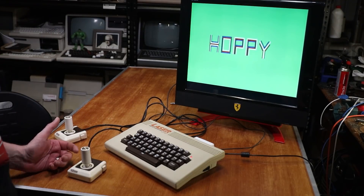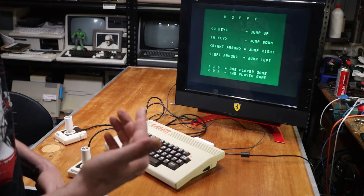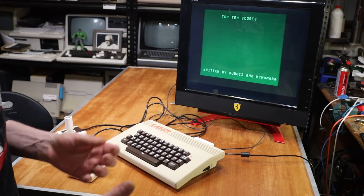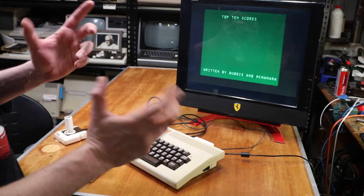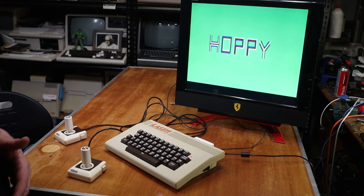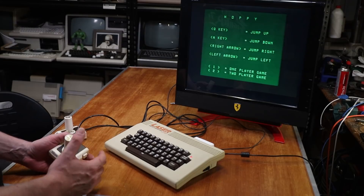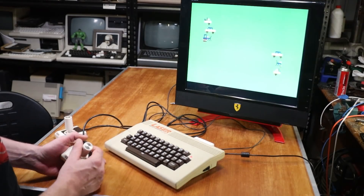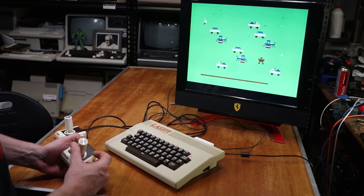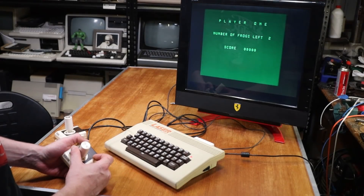The snow is basically similar to what you see on the early Sinclair machines like the ZX80, where you hit a key and the whole screen would need to refresh. It's very similar in the sense that there is constantly refreshing going on with the graphics, which is because it's pretty much all provided by the CPU, and you end up with artifacts on the screen. I seriously haven't got past the first screen.